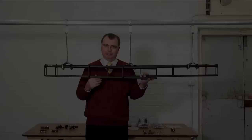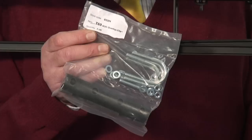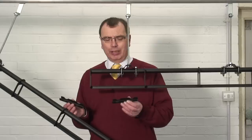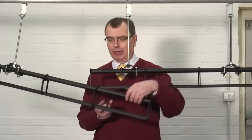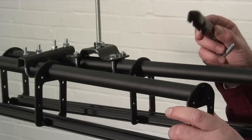In order to support the center of the track you need an overlap track clip, which looks like this — that's the kind of pack you'll get when you get your kit from the manufacturers. What you get is two little pieces of steel with little cutouts already in them. You put one on the front track and one on the rear track, then another piece on top, and then you have U-bolts that fit through.